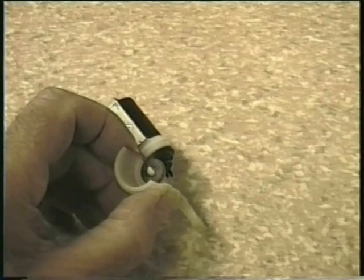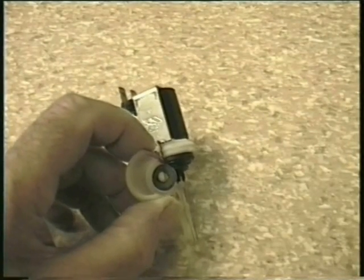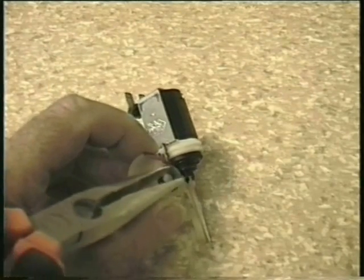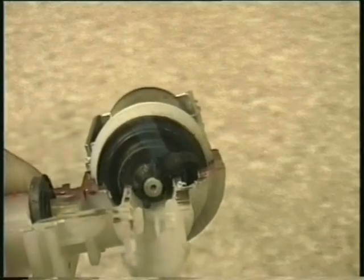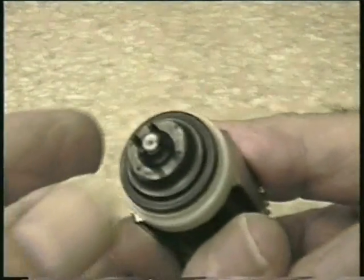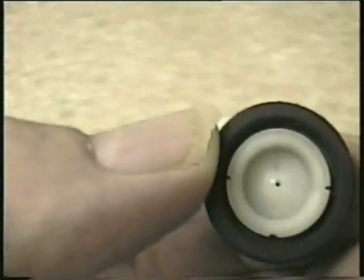If it's the cold valve that's affected it would cause the machine to stop during the rinse cycle, but if it's the hot valve then it wouldn't take the powder and you'd get a very bad wash. This will give you a first-hand look at the diaphragm, and you'll notice the larger hole in the centre which would be covered by the piston, compared to the small ones on the outer edge.